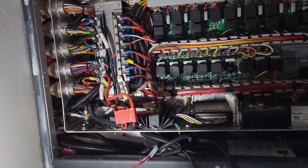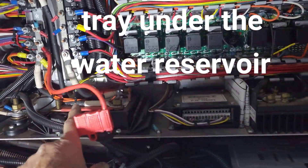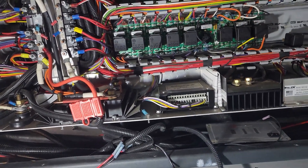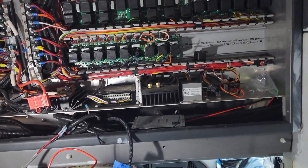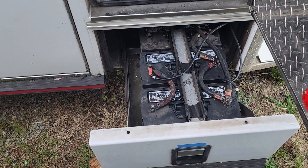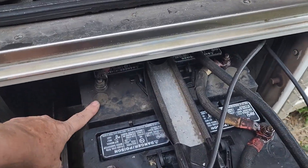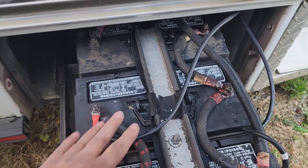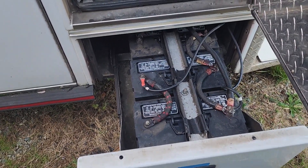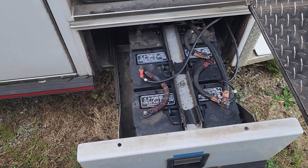Here's the electrical system and here was the input from the batteries. We're going to reroute this now to the house batteries so you can have all the controls separated from the truck batteries to the back batteries, so she can actually get this thing registered as an RV. We've got the cable, we're going to hook it up and everything should work great. She wanted to keep all existing wiring in it, which I like — I hate people ripping everything out. Here we have the house batteries and the truck batteries. They were all tied together. I isolated the truck battery, rerouted it, and these are going to be for the house batteries. She's going to keep the same batteries in for now, maybe lithium later. Everything is isolated. This job took four hours to complete.